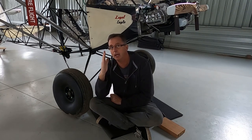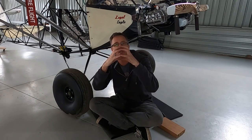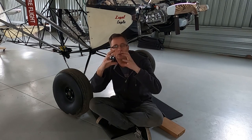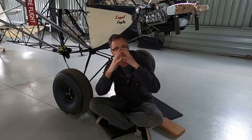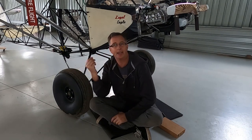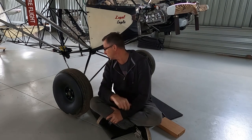Spinning the wheel, I had to make sure there was no shimmy. I did have shimmy initially and found out that the hubs, when I put them together, have room for movement. So it meant loosening off the bolts, lining the hubs up, tightening them a little bit — the three bolts that go through — giving it a spin to see how that looked. Once I was happy it wasn't shimmying, I tightened them all up quite strongly, and that worked out quite well. I had to do that again after I put the tyres on and inflated them, but ultimately it did work.